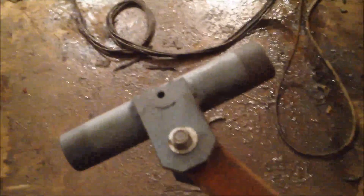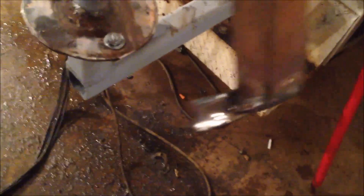To break the bead I made this — it's a piece of inch-and-a-quarter plumber's pipe that slides over top of that, and then made a little bent piece of angle welded onto this square tubing, I think inch-and-a-half by inch-and-a-half. I had to put a bolt in the top and then pretty much just pry down on the bead.